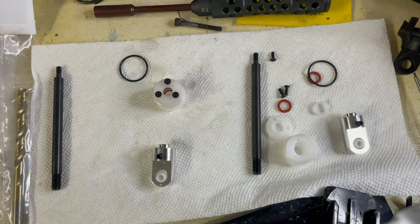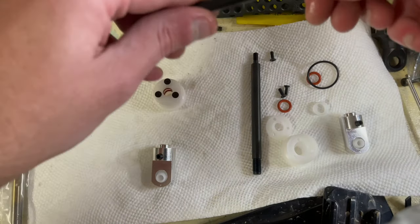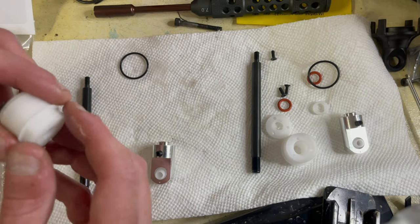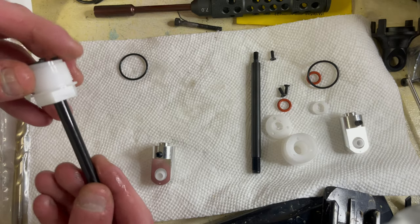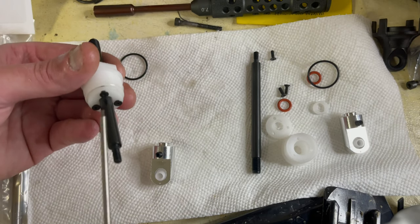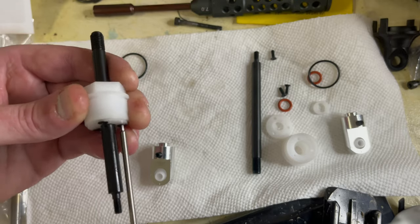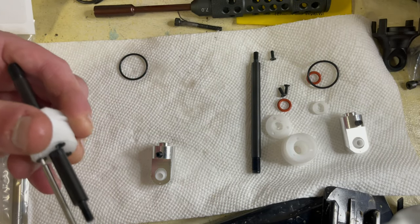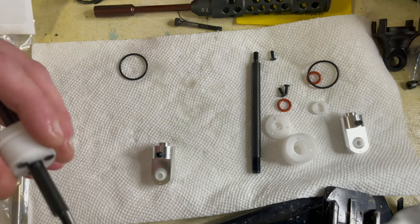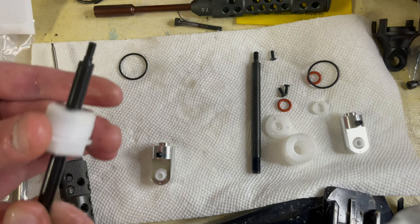I forgot to move up my shock shaft also — a little oil on the shock shaft. Now we're going to go ahead and stick our shock shaft through like that. I'm going to start to tighten it down. You should definitely be checking out Avery's video on M2C Racing and go subscribe to them — they're doing awesome things with this truck and a lot of other trucks too. Not too tight, just a little resistance.